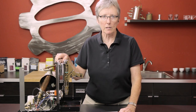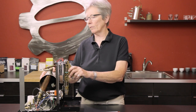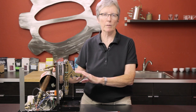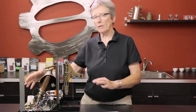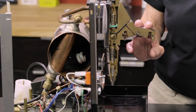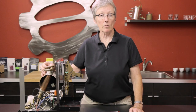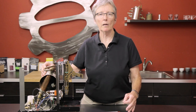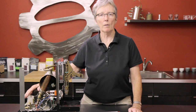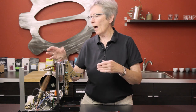We are still working under that same premise — temperature and bars of pressure — we just do it a little bit differently today. Better components on the inside, but a 15-bar pump back here still equates to nine bars up at the brew head. And if you have a pump that says it's 17 or 18 bars, I get this question all the time — it must be better, right? No, not necessarily. You still only need a 15-bar pump; anything over that is superfluous.